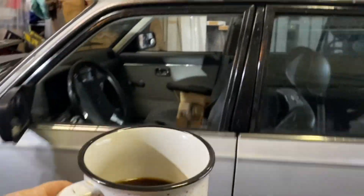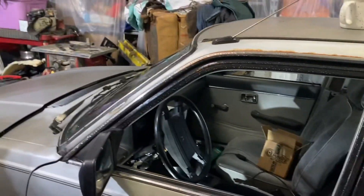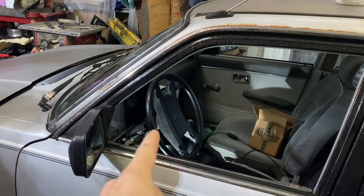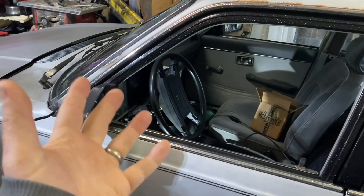So let's go over here. I'll show you what I found, and then we'll get to fixing it. Back in 1982, at least with this Honda, they were not running relays to run high-powered electrical systems such as the headlights — they were running it all through the headlight switch. Not the greatest idea they've ever had, honestly, but that's what they did.